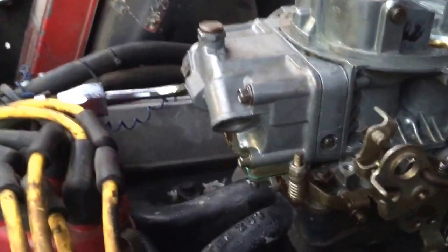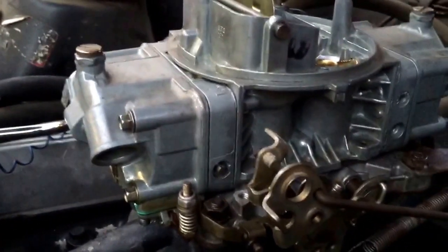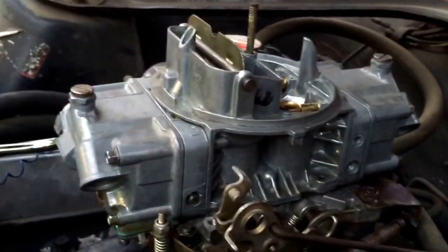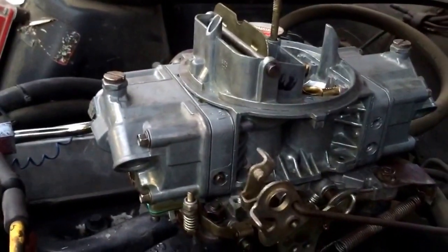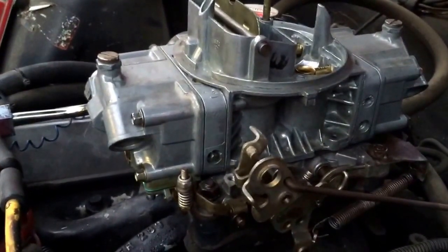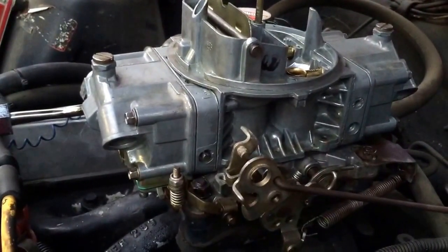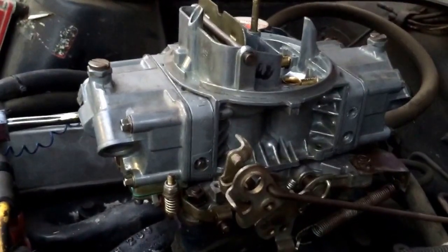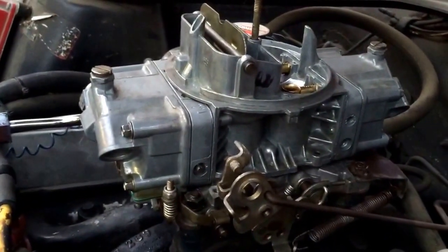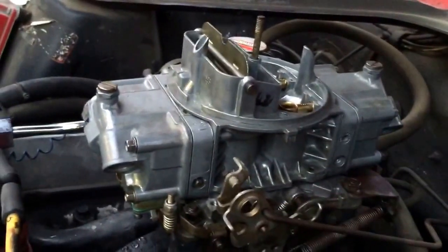This little component here is called the accelerator pump. I have a single pumper because I have vacuum secondaries — you only have a double pumper on a mechanical secondary setup. When you gun it, those throttle blades open in a fraction of a second and you get a huge inrush of air sucked in by manifold vacuum. The fuel is gravity-fed and pulled by Bernoulli's principle, but in that fraction of a second it takes the vacuum to pull fuel out at a higher rate, your car is going to bog out. That's why a misadjusted accelerator pump causes a bog when you hit the gas — then instantly it picks up once secondaries kick in.